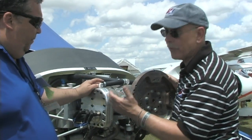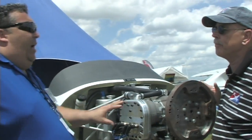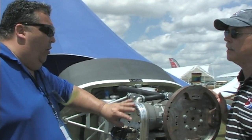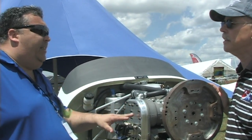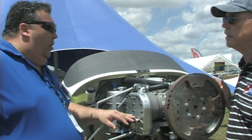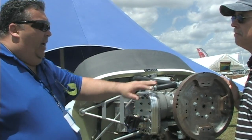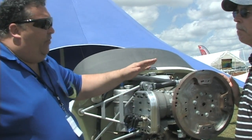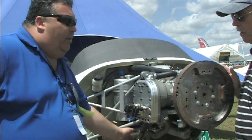What's the significance of a flathead engine? Well, you don't have the rocker arms and valves to get sucked in like a Volkswagen or any engine would. The engine itself is a flathead design, very simple like the old flathead Ford. The simplicity and fewer moving parts makes it lighter and more dependable. It has a 1,000-hour TBO time, so it's very dependable, it's direct drive, and it comes with the muffler included.